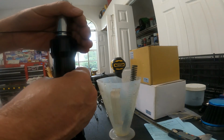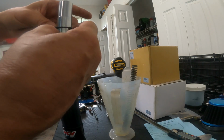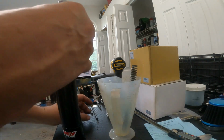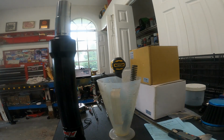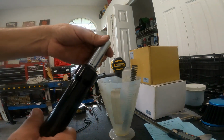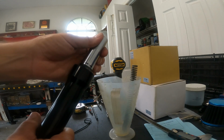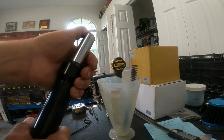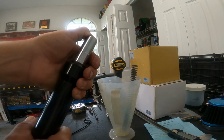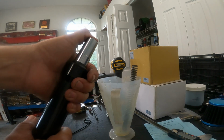And I know what you're saying. You're saying, but I've got them on mine and they work awesome. Best mod ever. Yeah, they're better than stock for right now. They're a little bit better than stock because they have that sag. Your wheel is going down into holes and coming up out of the holes, and your body's not. That's why it feels better. They've got the Gen 5 forks so tight, there is no sag.